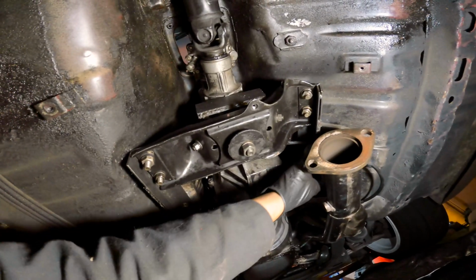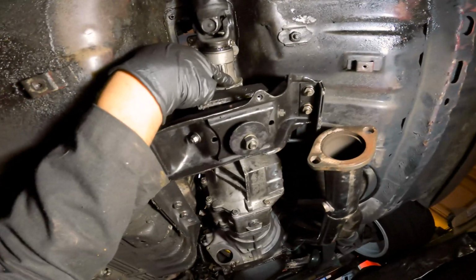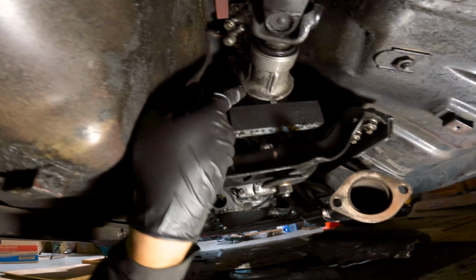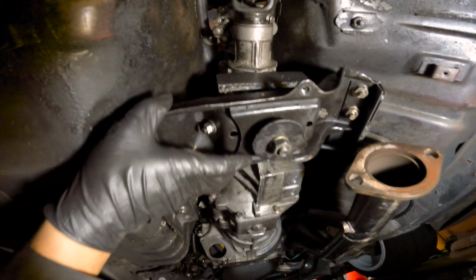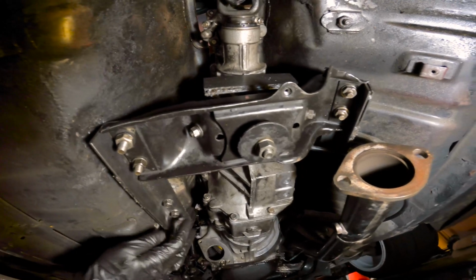It's okay, you'll learn. On an FC transmission, the transmission mount goes across here. On an NB transmission, it's being blocked by this guy, but there are two holes up here that the transmission can mount to. What I did was I got the stock transmission mount. I welded up this plate here for it to mount to the tail end of this tail shaft. And then I got some angled bars, cut and welded them, drilled two holes here, two holes there. So it's basically the same transmission mount, but just shifted back. And then these bars are just meant to reattach it to the stock holes.